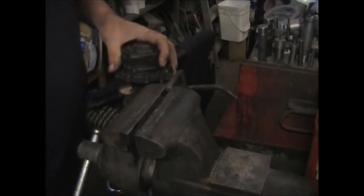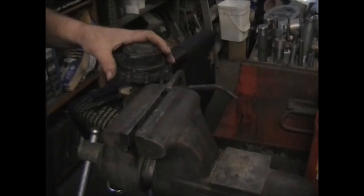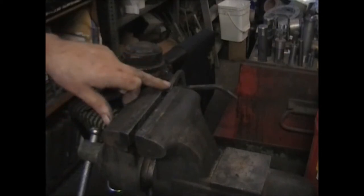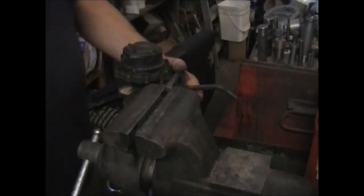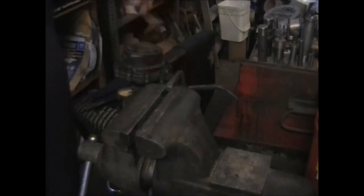The Packard 12 pump is one of the only pumps that I'll actually paint. These come through from the factory painted a shade of semi-gloss black. That's what I use — I cover these and paint them all up after they've been cleaned. If you're doing this at home, clamp it in the vise by one of these ears. It's pretty tough on these ones, so you have to be real careful, unless you have some kind of a jig that you can bolt to it and mount it up high.